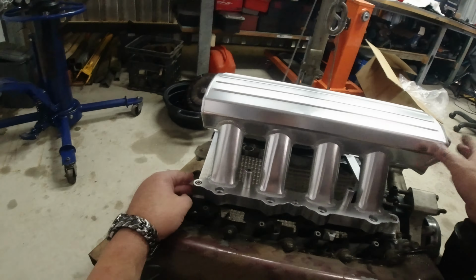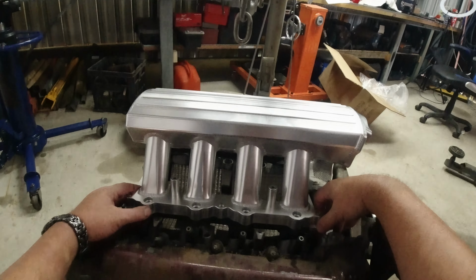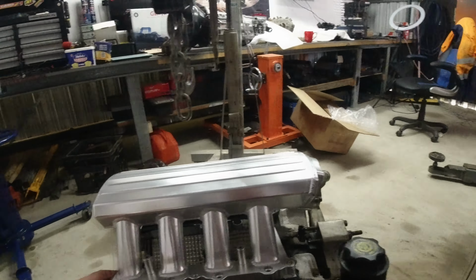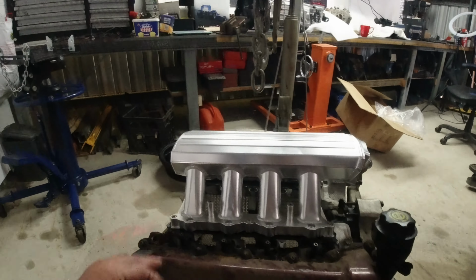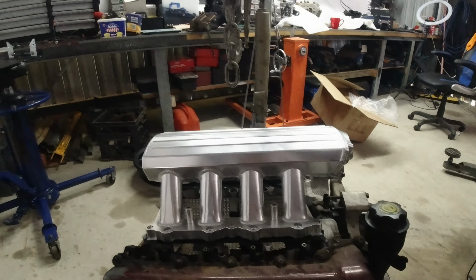So yeah, I'm going to have to get some aluminium bar. That's probably 70 millimeters wide by probably a similar thickness, 20 mil thick. I wonder if I could draw it up and get someone to cut it out. Anybody here watching? If I give you the dimensions, that'd be cool if it could be CNC'd.